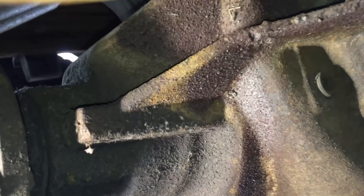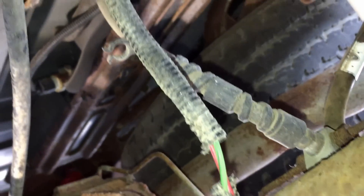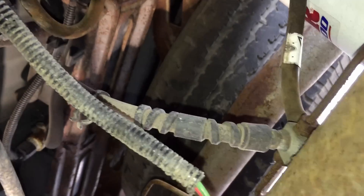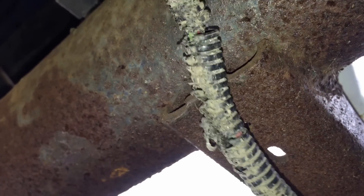Real quick — rear diff sensors and C1230s are very common for the coil inside to break, and it can be intermittent where you're going down the road and the code just pops up on your screen. But what's also a good thing to check is what you see here: mice damage, rubbing on the frame, as the harness goes up and over to the main harness on the frame. That section that branches off has potential for road debris and mice damage, and this one has mice damage in a few different spots.